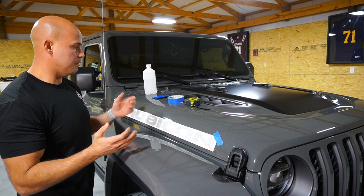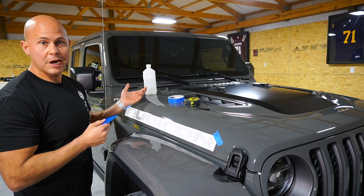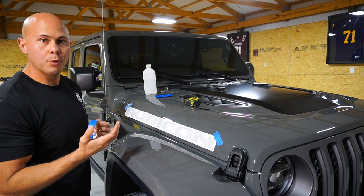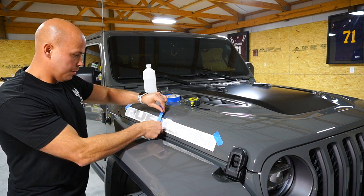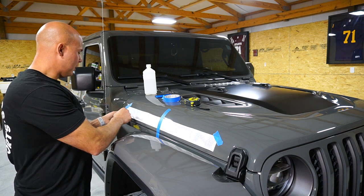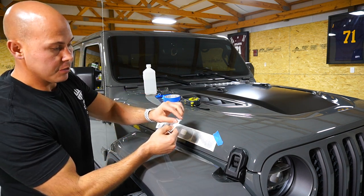All you really need to do this is some tape, a tape measure, and a squeegee — I got mine off Amazon for about five or six bucks, I'll put it in the description. I used alcohol to clean it and I'm going to install it with the dry method. I know there's a wet method — it's all preference. The next thing I'm going to do is put a hinge point here to hinge off of. I'm going to use the eye as the hinge point, go ahead and place the tape, which will allow me to undo the decal, pull it back to hinge against, and then start to remove the backing.